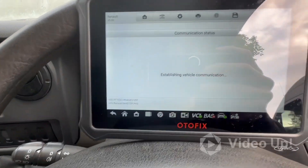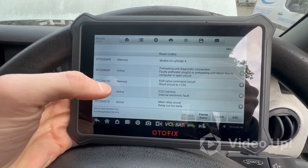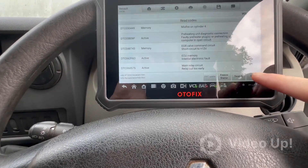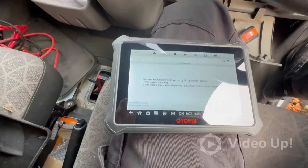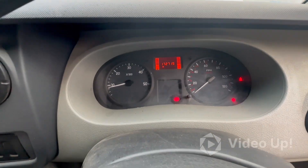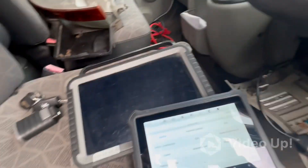We'll get the scanner on it — let's see what faults we've got in the engine ECU. We've got misfires which are memory, a preheating unit fault which we're not bothered about, ECU internal electric fault, electronic fault on the main relay circuit — I think these are going to be past faults from the other engine ECU, so we'll see if they clear. Long story short, I had a nightmare — had to end up using the Autel, as the other tool wasn't doing it right. I had to re-enter the injection codes because they were all sevens, so something must have happened with the EEPROM when changing it over and it lost that memory. But as you can see, no warning lights on — happy days! Thanks for watching, see you next time.